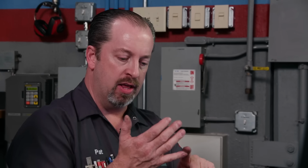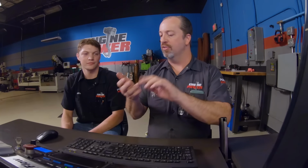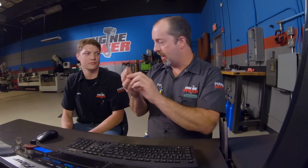That's like 3.3. It's 3.31 per cube if you do the math. And it still has 102 pounds of oil pressure. Keep in mind, this has the stock forged crankshaft in it, which is a good crank. It's got a sleeved block, but still a stock block. We have some nice parts in it, but we've just taken an engine with basically stock architecture, put a big blower on it, and throw 21 pounds of boost at it, and it makes 1,000 horse. That's crazy. I mean, boost solves everything.